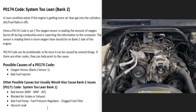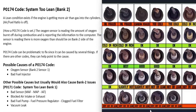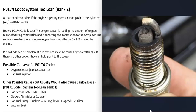If you're not getting any other codes and can't figure out which cylinders on Bank 2 are running lean, you can remove the spark plugs one at a time and compare them to a spark plug burn chart. The condition of the spark plug will tell you whether that cylinder is running rich, lean, or normal. This helps you narrow down whether all of Bank 2 is affected or just one cylinder, so you can focus your diagnosis on the problem cylinders.